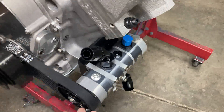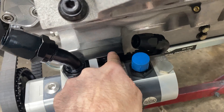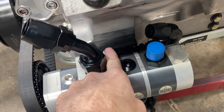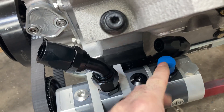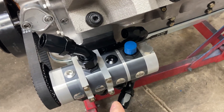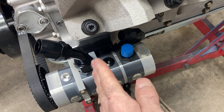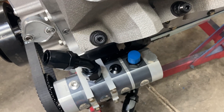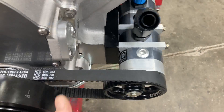We had to do a lot of modifications to these ABA parts. This block mount right here — the pump mounts to it with these four bolts. The bolt holes in this block were over a full diameter off in one direction. So we had to put some aluminum studs, lock-tighted those in, and since the holes were so close to each other we didn't want it breaking out. So we plugged the holes, drilled and tapped — everything is the way it should be now.